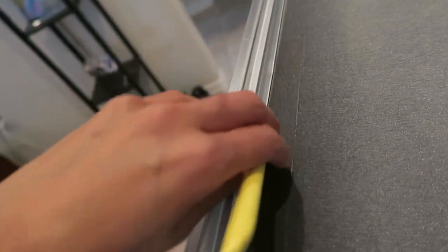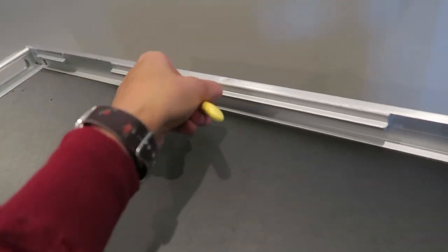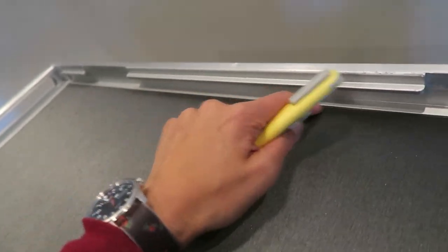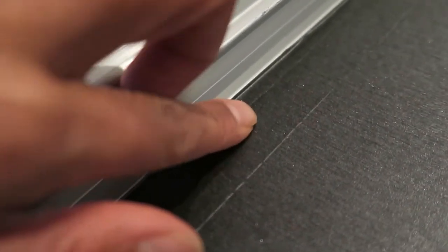When I was cutting I was pushing up against this rail which worked really great, but then I decided to cut from a different position which didn't let me push against the rail and my blade went erp. Make sure the blade has firm pressure against a rail so you get a good cut. I added an extra strip on one side when I had problems with the cutting - it's barely noticeable.